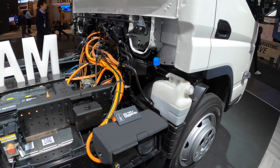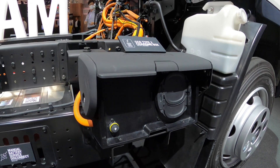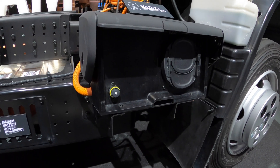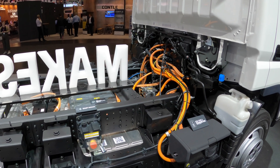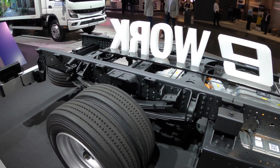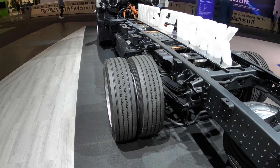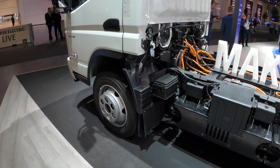You can see the LED lights at the rear as well. Charging: when launched in Japan it featured a Type 2 AC and CHAdeMO, but here in Europe we have CCS. AC charging is 11 kW on the smaller battery, going up to 22 kW for the medium and large battery. Charging times are 4, 5, and 6 hours respectively depending on battery size. DC peak charging is 70 kW on the smaller battery and 104 kW peak on the larger battery, with 70 kW continuous. That gives you 0–90% in 36 minutes, 44 minutes for the two smaller sizes, and 1 hour 50 minutes for the large battery.